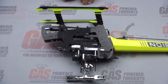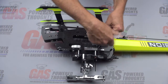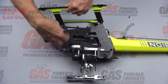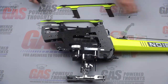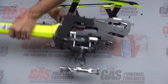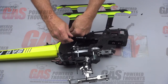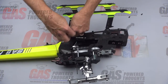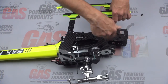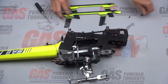We're going to take the landing gear from the original donor model and just unbolt it from the landing gear braces at the bottom of the frame. Those are four millimeter bolts and they come right off. That was the right side; now I'm going to flip the model over and take off the left side the same way. If you intend to use the original landing gear braces, you can take the whole thing off as a unit. I'm going to use a set of KDE reinforced landing gear braces, so I'm just going to leave the originals in the model for now.